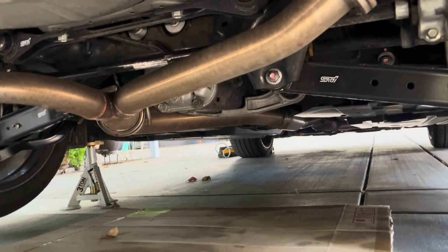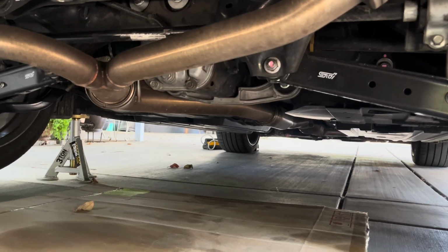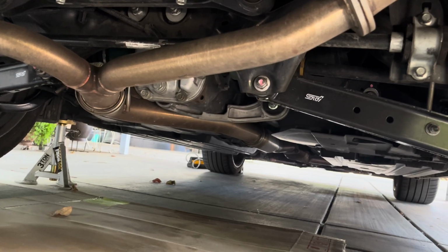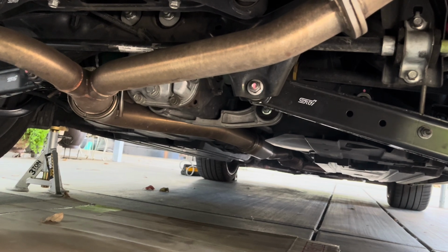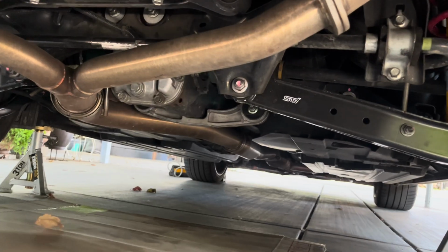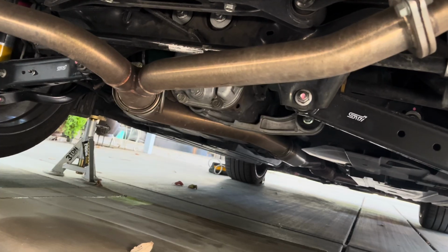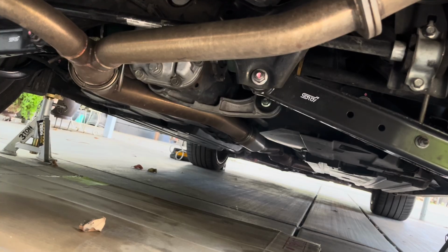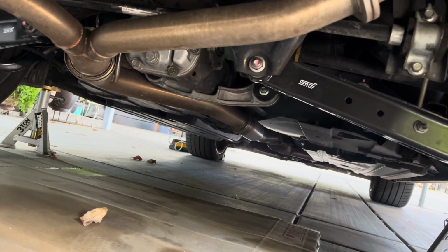I don't like that the Killer B one takes away some ground clearance, same with the IAG. And I don't like that the competition ones have those little rubber gates to let oil come in but not go out. They probably won't fail, but I'm just paranoid about them failing. I do like the Roger Clark pan, but that one does have a couple of those rubber gates. And I do like the Killer B one, but again, I don't like that it takes away some ground clearance.